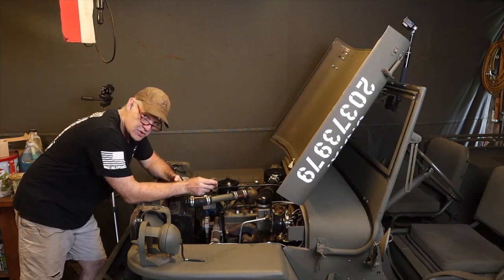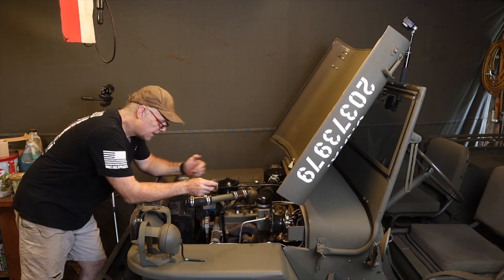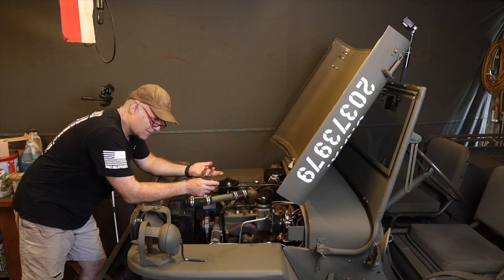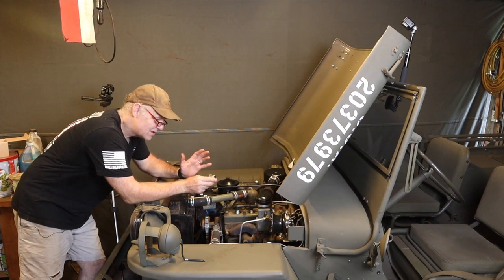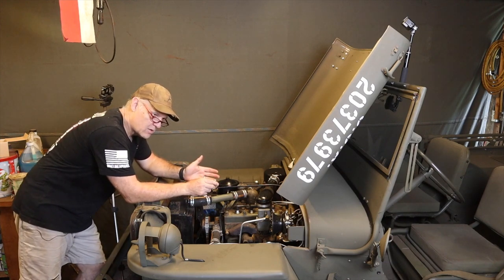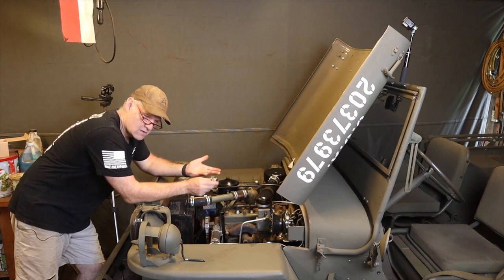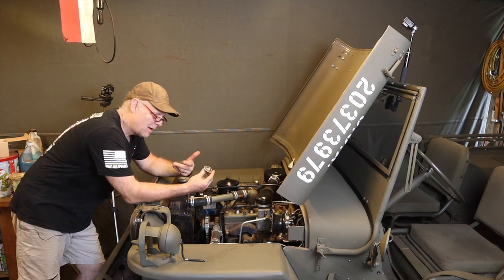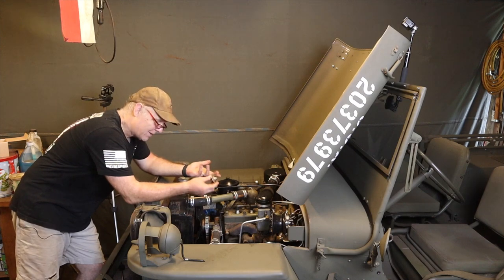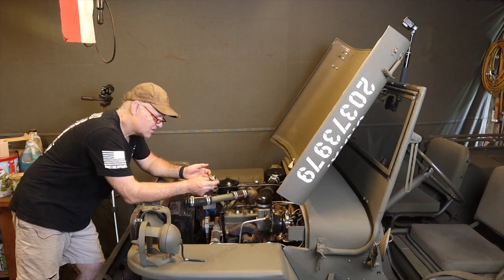Now, with a proper functioning radiator and a proper functioning water pump, what you should have is that the temperature goes back down to something around 160 to 180 degrees. So yesterday I drove the Jeep for 4.5 hours and I never saw more than 178. So I was really happy. It was running around 175 pretty much the entire time. So by my calculations, man, that is dead nuts perfect. But all of a sudden I'm driving home and it just popped up like the water wasn't circulating.